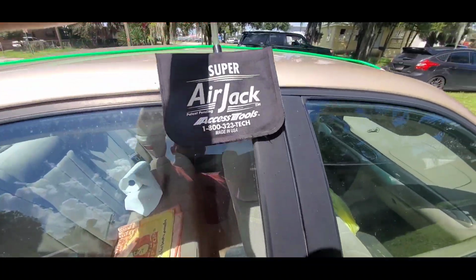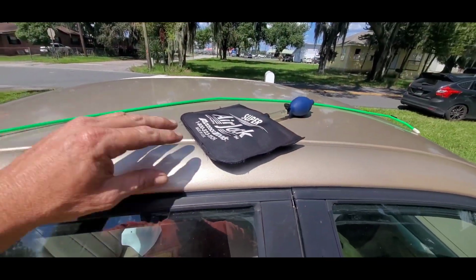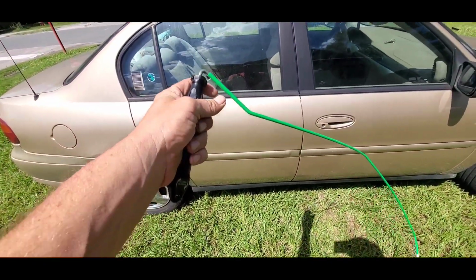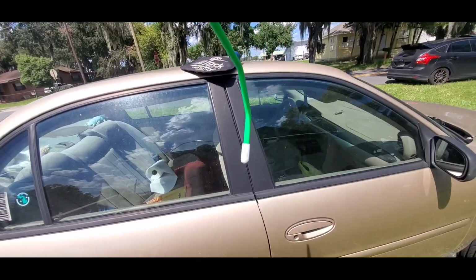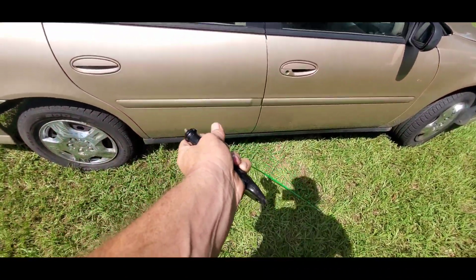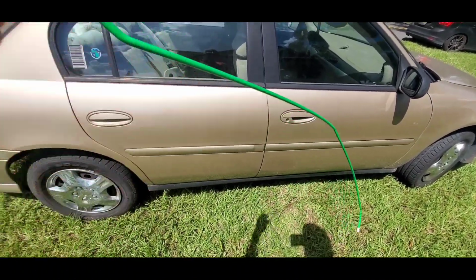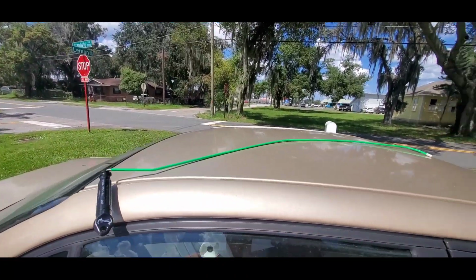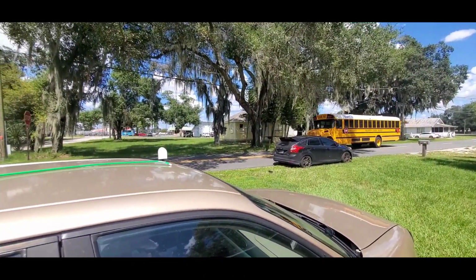If you're doing it yourself, you can go to Home Depot and get a similar bag from the door and window aisle. I also use Access Tools Green Reach Tool. This is a quarter inch metal rod coated in plastic, and it has this rubber tip on the end of it so it won't break your windshield or your glass, and it has this handle at the end so you can make all your maneuvers. And if you don't have that, you can make it out of quarter inch metal rod in the metal aisle at Home Depot.